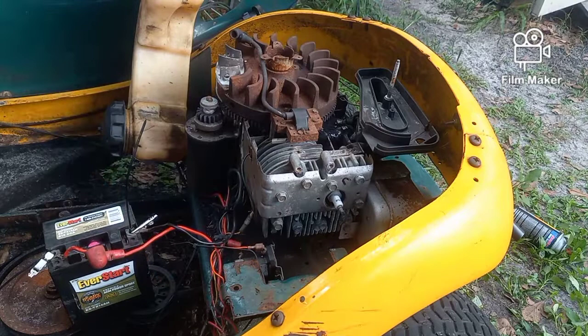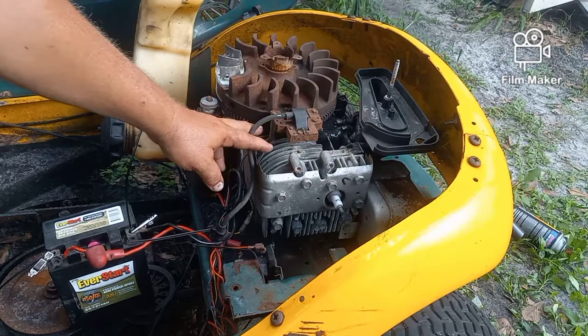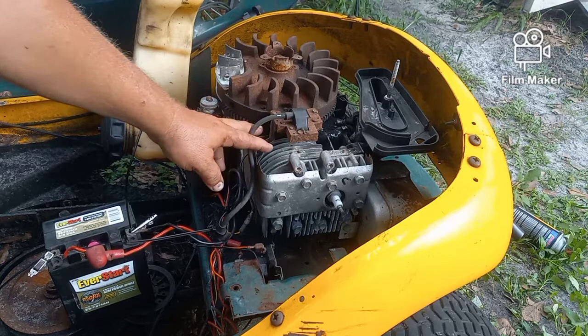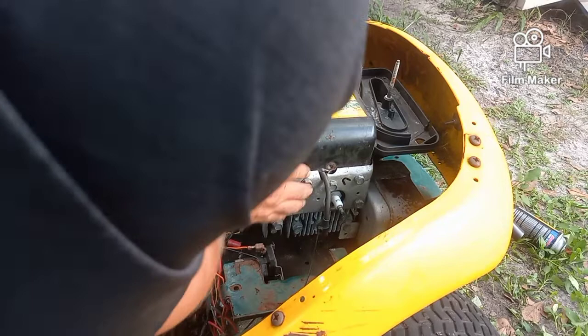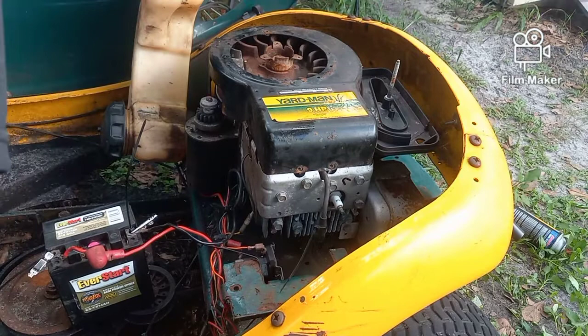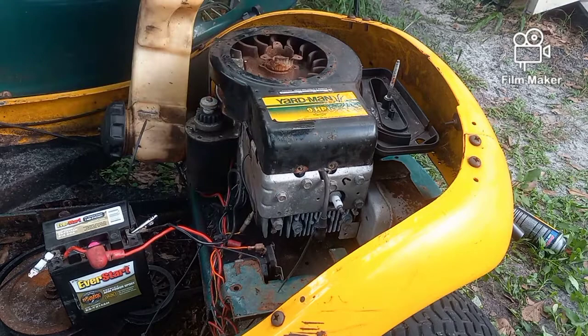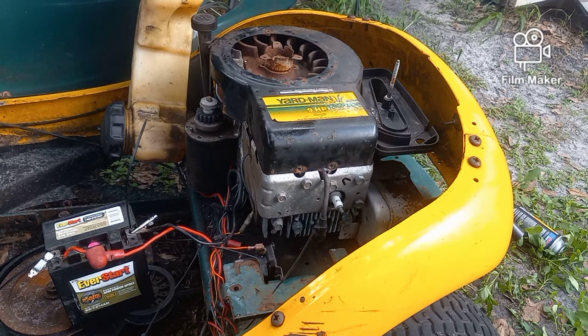You take that wire off — you don't even have to put your cover back on, it'll run just fine. Well, your oil dipstick is out, so take care of that. Put everything back on — fit that back in place — and put your bolts back in, one, two, three, four. Get your dipstick and put your dipstick back in, because if you don't, when you turn over the motor it's going to shoot oil out from where the dipstick is. Stick your dipstick back in place, put your little fitting, put all your bolts back in.